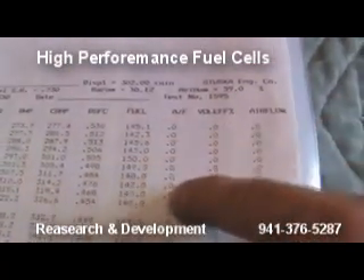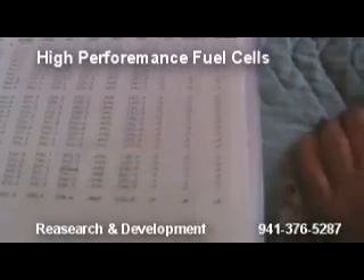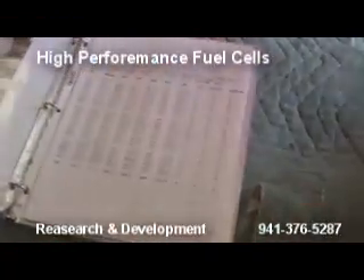This is what we're going to be setting here today — your air fuel ratio. With these older style motors you want to see them running about 12.8. That's where they make the most horsepower. They're not the most fuel efficient, but the most horsepower. The hydrogen is going to help with fuel efficiency.